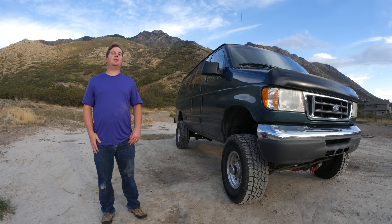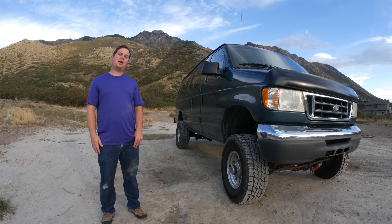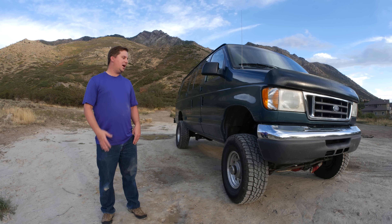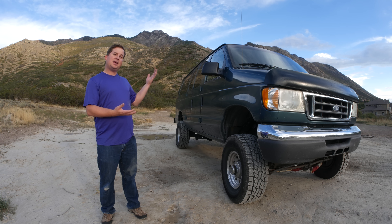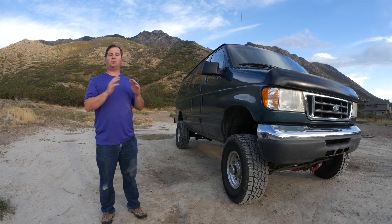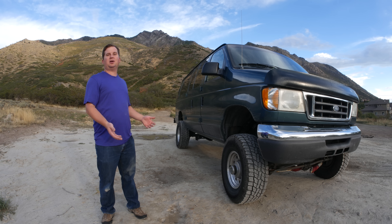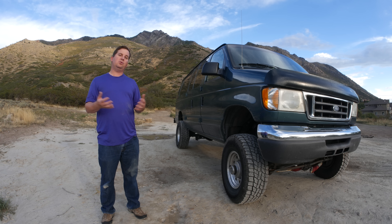I've been a big fan of Chris at U-Joint Off-Road's vans — he builds some of the coolest vans out there, and from the reports we've read, everybody loves the handling on them far better than stock. So we reached out to Chris and partnered with him, so he'll be sponsoring this build. We came up with the idea of running a 6-inch lift kit from U-Joint Off-Road. That shouldn't lift the van too much, but there are some significant changes that need to be made. First off, the front shackle will be moved to the back, which is wonderful — which should have happened from day one. Also, the springs are longer, so they're not going to bottom out as quick on whoops and on the road and off-road. It should be a much more controlled, smoother ride.